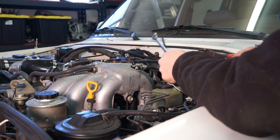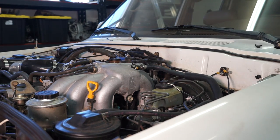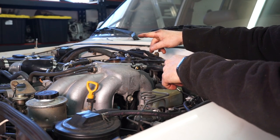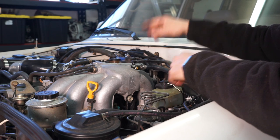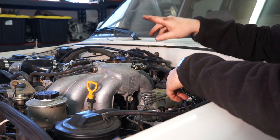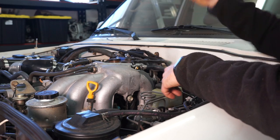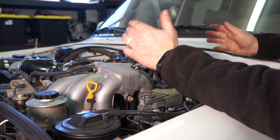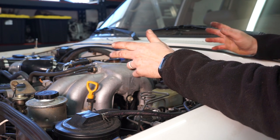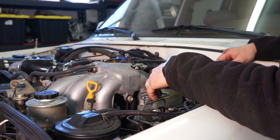The only thing that I haven't shown on the video is the exhaust mating up. And with the Wits End kit, you're gonna cut your factory downpipe right above the converter where the two merge pipes come together and weld in the Wits End adapter. Because we're going full stainless exhaust on this one with the OTRAMM kit, I just went ahead and made up a new front cat pipe that goes from the Wits End downpipe to our exhaust. So it'll be a little bit different than what most folks would run. So that's in there.